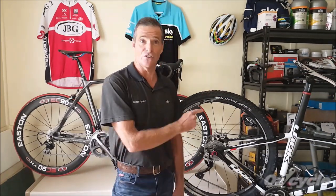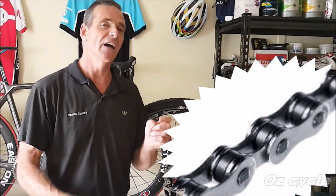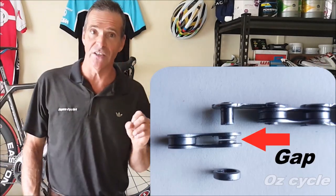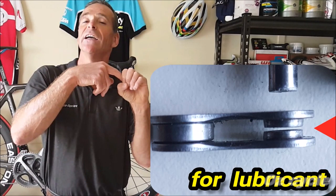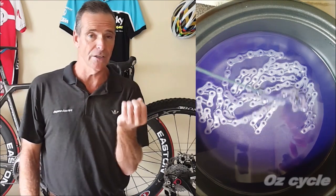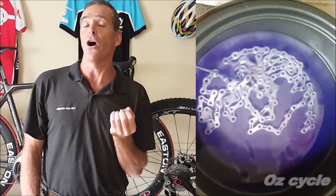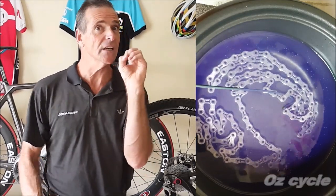To sum up: your chain is the determining factor of wear on your drivetrain. First, keep your chain nice and clean on the outside so it doesn't attract dirt that then makes its way inside. Secondly, make sure your chain is well lubricated — not just a light lube, spin it and that's it. No, it has to be lubricated on the inside, all the way under the roller, in the bushing and the pin area. One of the best ways is to soak the chain in lubricant for quite some time. Wax baths — hot wax baths — are really good at doing that. Make sure that lubricant gets well on the inside and keep a nice clean chain on the outside.